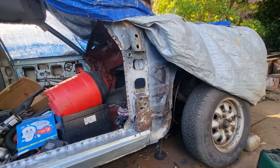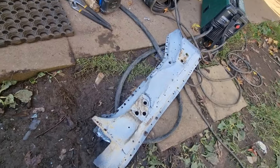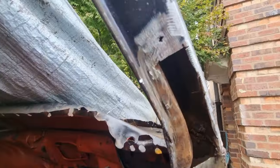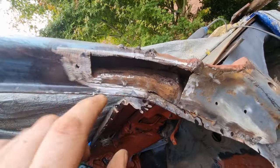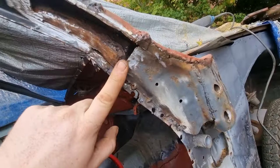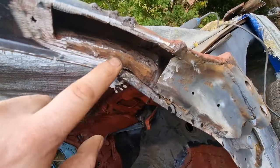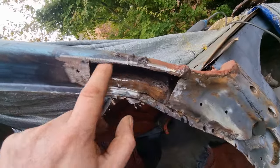Now I'm just cleaning up that post, and then I've got to do some work to that and get that welded back on. Now I've just got to fix this all in the window frame. I've got to bring a piece of metal down and connect it to this bracket, so it's flush up there. I've cleaned up in there as best as I can, going to put some brush treatment in. I'm just going to make a plate in there that comes down here and connects to this.